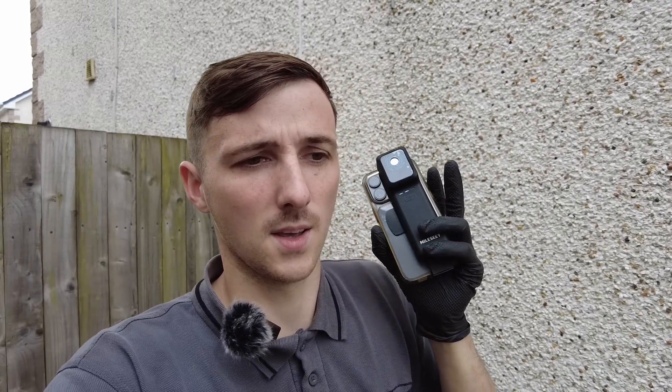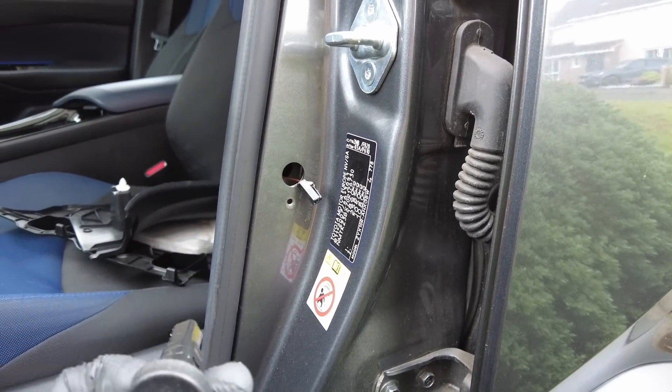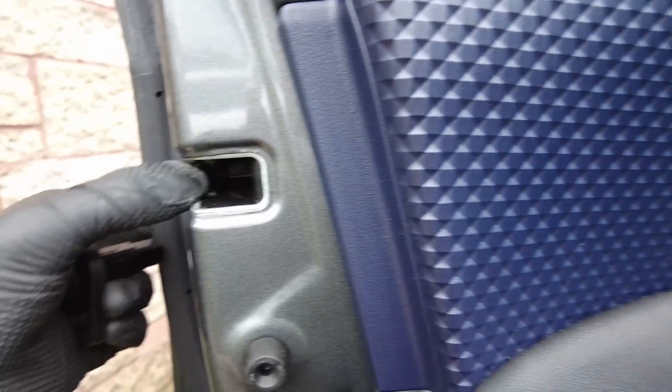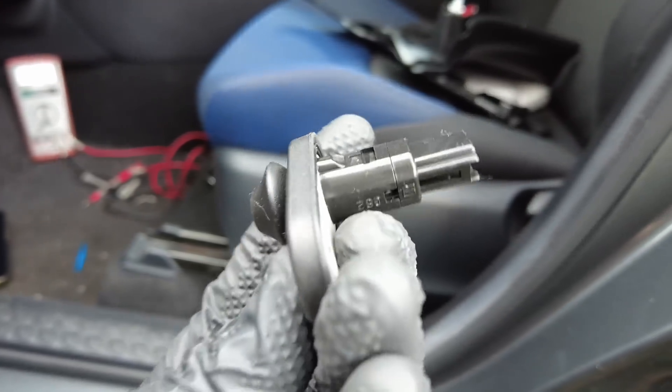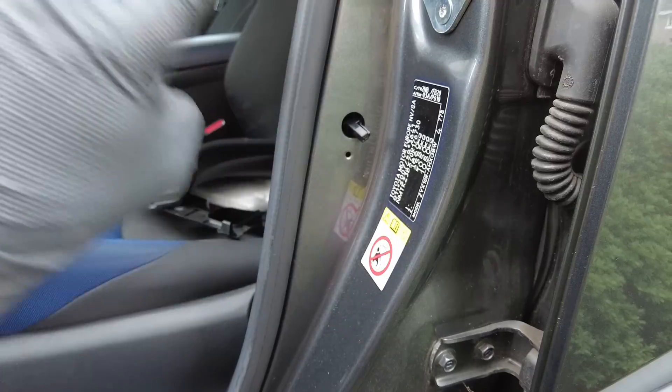The backstory with this car is it was jump-started with reverse polarity, and it ended up having to get recovered to Toyota to resolve the no-start condition. It had blown a couple of fuses, and the customer said Toyota fitted a new fuse box. The likely chance of that little dash cam box being spiked at the same time is pretty high. Also, a quick tip: if you want to carry out a parasitic draw test on a car with these similar door switches, I usually just disconnect them and latch the door — it's only held in by one bolt and the car still recognises the door as shut, preventing interior lights from coming on.